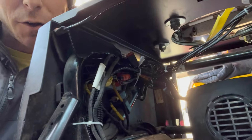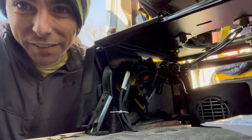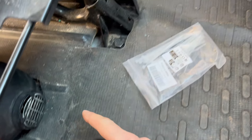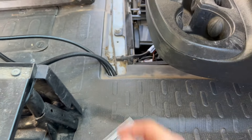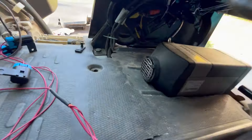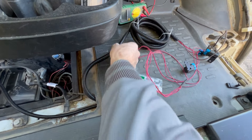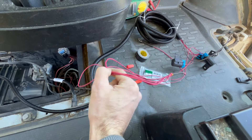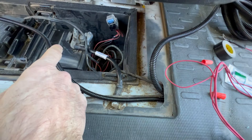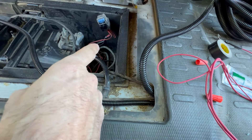What I'm doing right now is the Webasto - the new controller for the Webasto heater. You can see the cable going up and there are already cables here for the seat. I tried to get it really nicely routed up on the side. From this angle it goes down under here, over to the batteries, and then up to where the controller is. We got the cables running over to the battery area. They envision you running this right to a battery terminal, but what I'm going to do is use these Wago connectors.